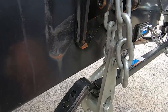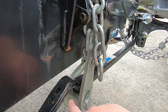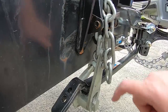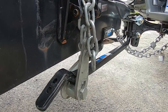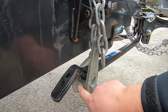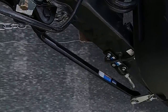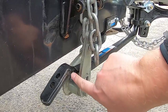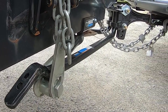When everything's nice and lined up and that trailer wants to move out a little bit, it's got to bend this bar one way or another. With the truck turned hard right you can see this bar gets pulled forward because the hitch head rotates — so the point sitting on the cam has to come forward as well, causing the bar to raise. That bar is continually trying to push downforce to keep equilibrium, balanced off with a similar effect on the other side. Both sides are working really hard to come back to equilibrium, which is having the cams sitting at the high point. There is some friction with this as well — the instructions recommend not lubricating it too much; you could put a tiny bit of grease just to take the popping sound out.